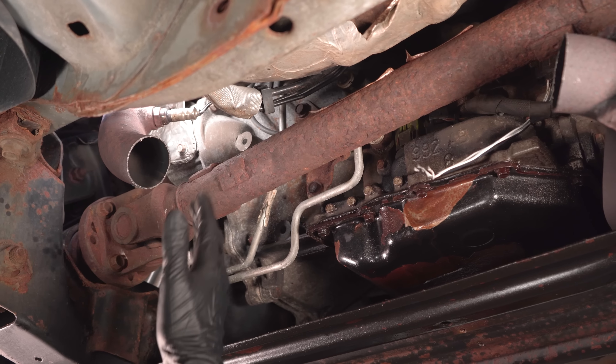It's not always complicated to replace these, especially if you own an SUV or truck where there's a lot more space underneath. It might have a couple of skid shields, but a couple of bolts and it's wide open — a lot easier to replace. Even with a smaller car, a smaller engine means a smaller pipe and smaller things fit more easily. So following this pipe all the way back, it leads into the muffler. This clamp is in pretty poor condition and there's an exhaust leak — you can see black soot built up here from carbon buildup. Exhaust leaks are bad and I'm going to fix it — that clamp needs to be replaced and these two pipes need to be separated.